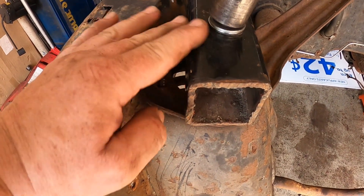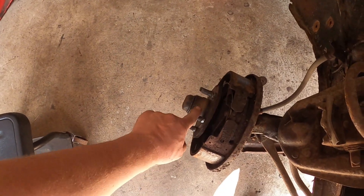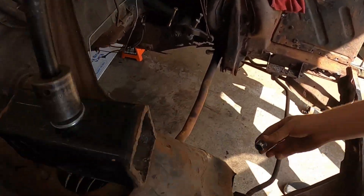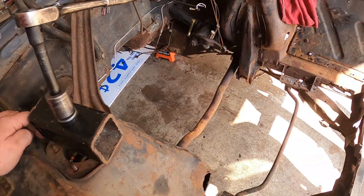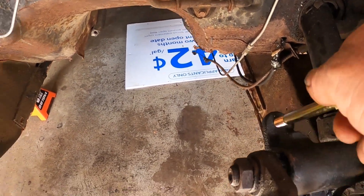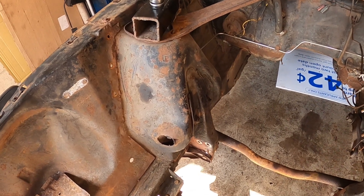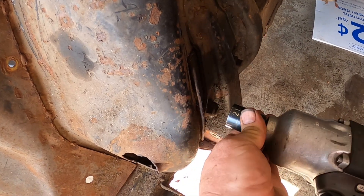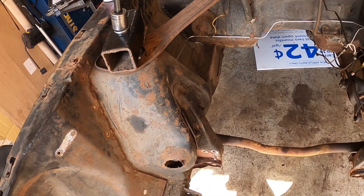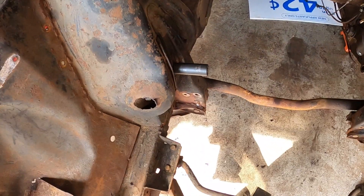While G Junior gets that, let me show you — this is just a piece of trailer hitch that I cut to give me the extra space I needed to compress the spring. We also got a new bolt for the steering box at the hardware store, two new bolts for the idler arm, and a brand new idler arm. The nut is 19 — not 21 — go ahead and just loosen that one a little bit.